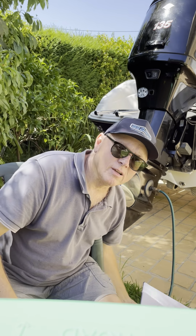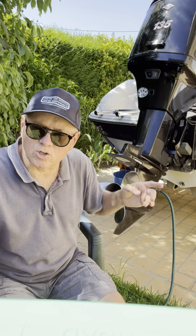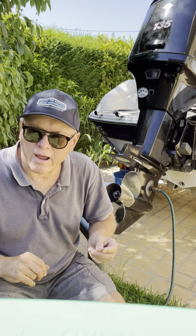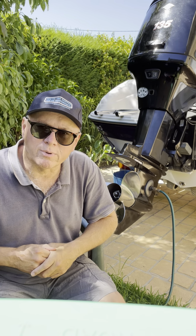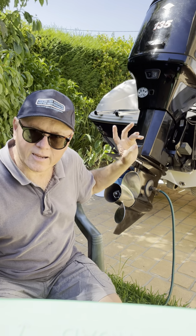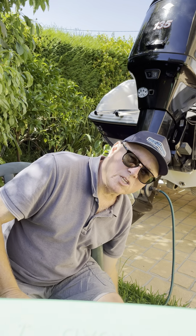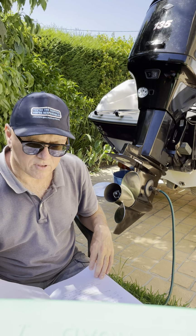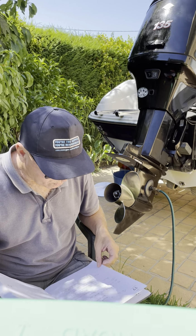Next one, there is a little strainer. What happens on the air compressors to these things, it's actually cooled with the same water that's used to cool the engine, and it runs through a little strainer. And if that strainer gets clogged up with mud or crap, then the water supply to the compressor gets cut off. And you'll know this, because the telltale water that comes at the back of the engine actually is the water that's come through the compressor. So if your telltale's weak or stopped, then you'll know that that strainer is blocked and you'll have to clean it. And I believe it's quite hard to get to, so that might be one you'll have to leave for a mechanic to do. I haven't done it, but happily my telltale is still pretty good.